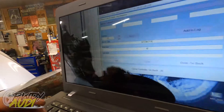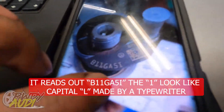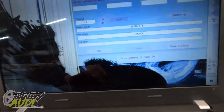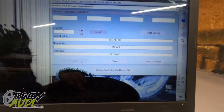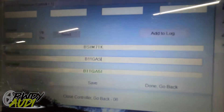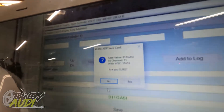So the first injector is... B, B. Is that an L or a 1? G, A. This is one of those cases where that looks like a 5 or an S. We're going to find out — let's go with 5I. We'll go down here to test. It worked! It came back with the exact same number, so it matches. Then we go over here and click save. Save new value — are you sure? Yes.